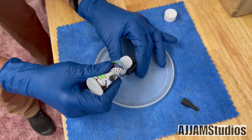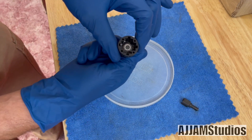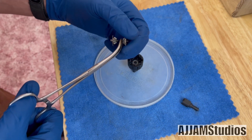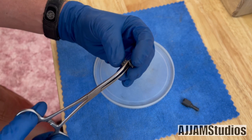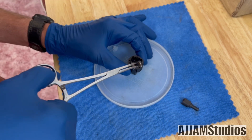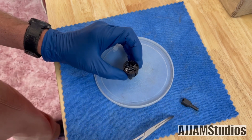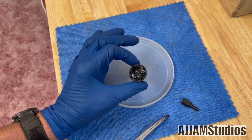Now we're going to throw just a little bit of base oil down on the bottom — just enough to coat everything down there and get the oil worked in below that plate. Now we're going to put the planetaries in. Make sure the notch is up and line those shims so the textured section is upward — that's the only way they're going to slide in. They don't have to be spread apart — they'll fit down in there narrow. Once you get them down in, you can widen them afterwards. Work them down in the hole, push them to the sides, and sink it down with your finger. Turn it so they settle in place.